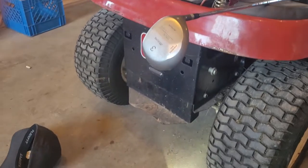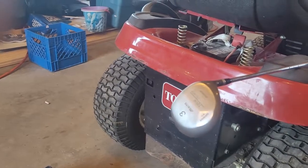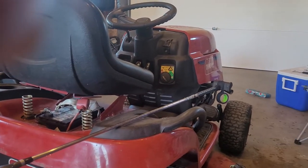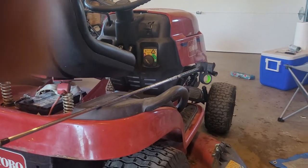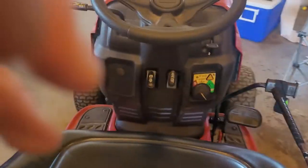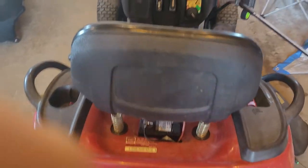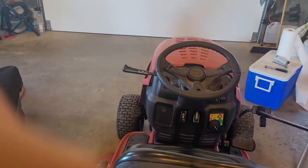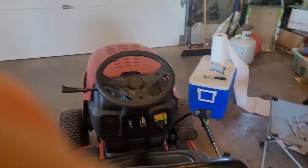The bolt that connects that bent plate — again, watch the detailed video, easy to find by searching 'ride-on lawn mower brakes' — was loose. I tightened that nut, put the tractor in neutral, and tested it. I pushed along with my foot and then pushed the golf club — and I think I've got brakes. All I did was tighten that nut.